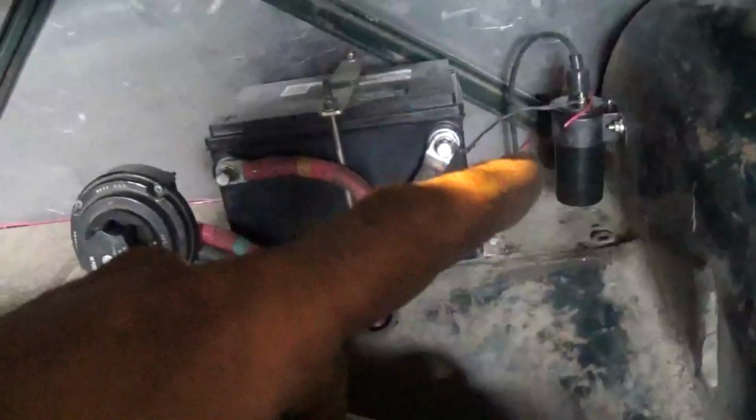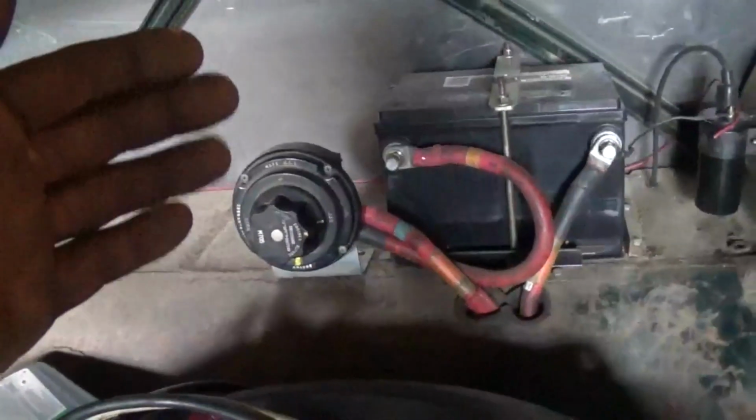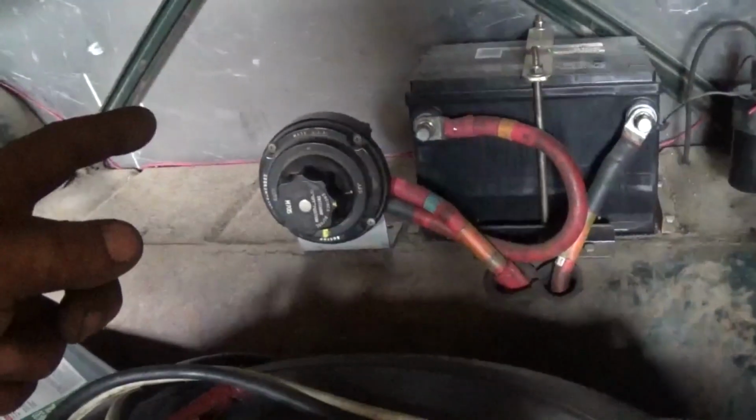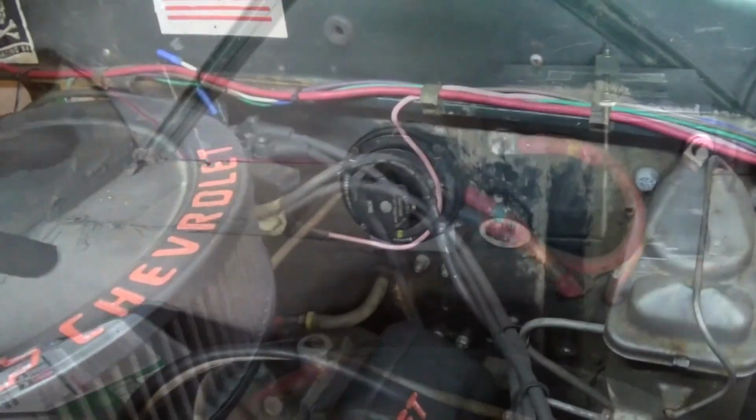And I got it run over the wheel well over to my coil. I'm going to hook that up right now, put the back seat back in, and then I can move on under the hood, split the coil wire on the cap under the hood, put the relay out there and get that stuff wired up and brought into the car, and we're almost done.